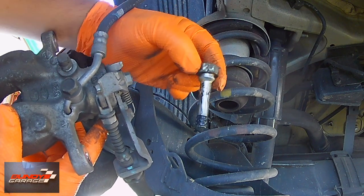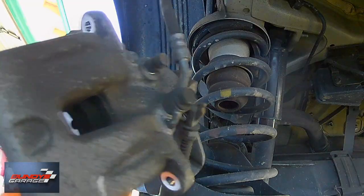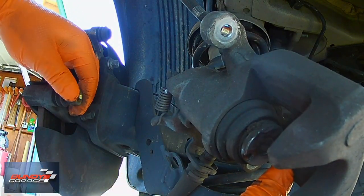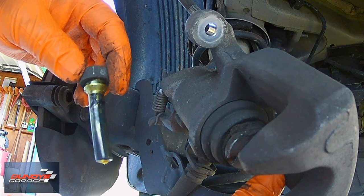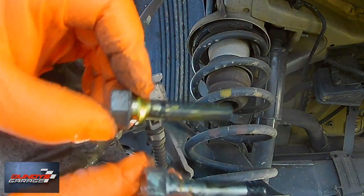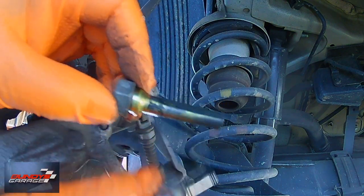You have to have the emergency brake off or you won't be able to get that caliper off. There's one of the slide pins — you can see it has a rubber on it, and then the other slide pin doesn't. I'll put a link in the description below where I go over the theory of rubber on your caliper brake pin. Most of the time I just rip it off, sometimes I'll leave it on.